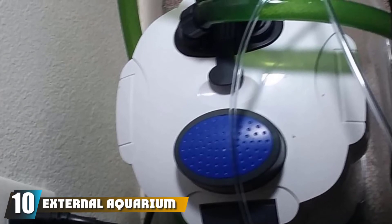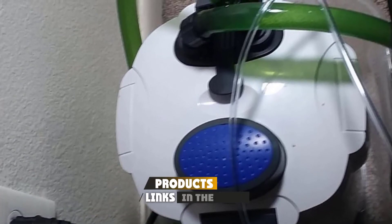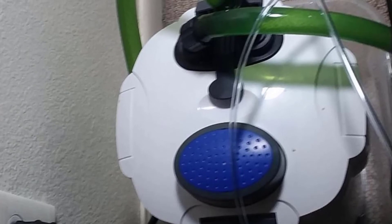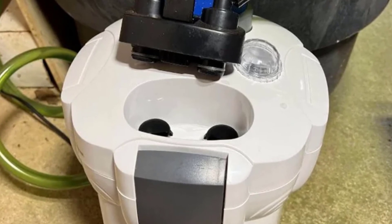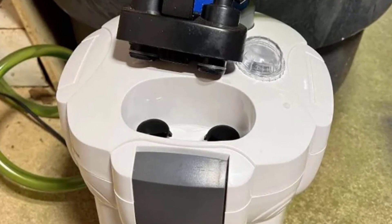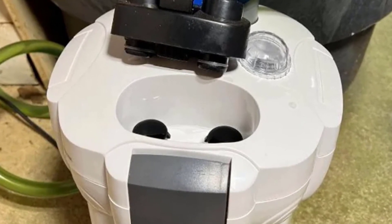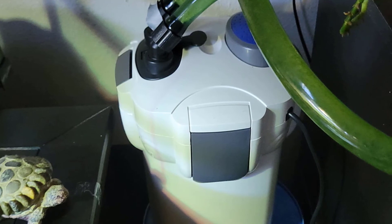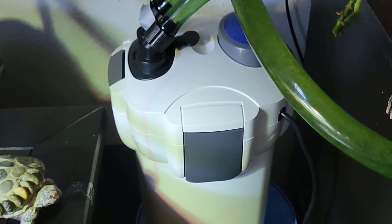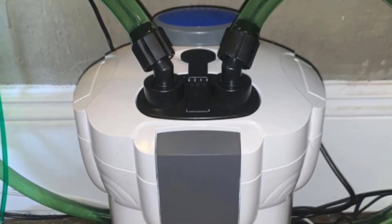Finally, the number ten position is dominated by the External Aquarium Filter by Polar Aurora. Even with all the flow, the system is pretty quiet — the impeller is well-designed to reduce vibrations, and the canister lid features a lubricated rubber seal to keep noise inside. There's also a priming button to remove air and prepare the pump for use. Below the pump, the unit has a spacious canister with several media baskets. The smallest model includes three baskets for full three-stage filtration, while the largest has four baskets for additional treatments. The valves swivel for easy positioning, and the lid features a fixed clamp cover for added protection against leaks.